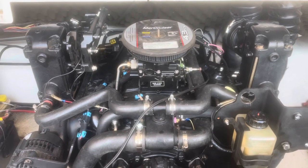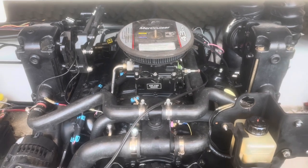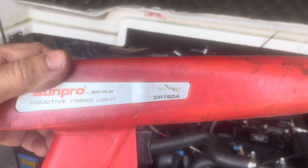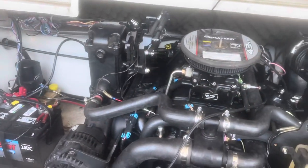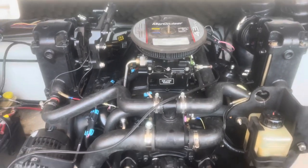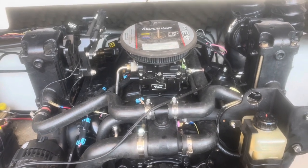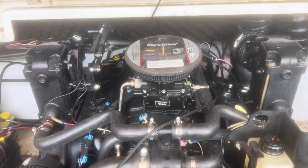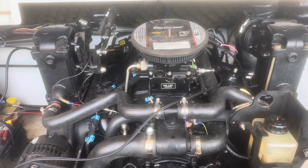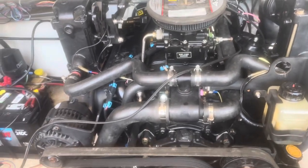That's not the final step. The final step is to set dynamic timing on a running engine, and to do that you need a timing light, which is this right here. I've had this for years — it's a xenon timing light, which is better than the neon. I've got the timing light hooked up. I believe this is going to be either the fifth or sixth video in this series called the Spark the Eel series playlist, and up to everything I've done now, you've worked on an engine that's not running. So in this step, to do the timing, you have to have the engine running.